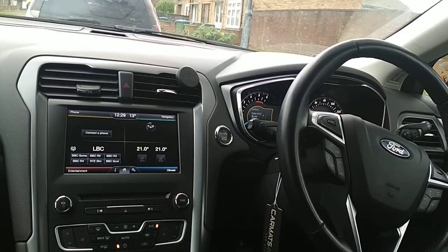So get a double flash. Push the AC button five times — one, two, three, four, five. Five flashes to confirm — that's now in valet mode.